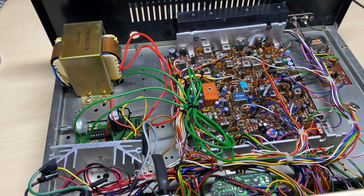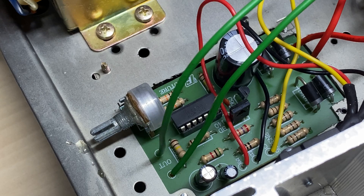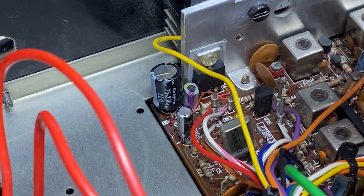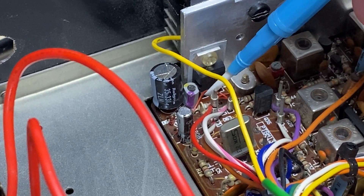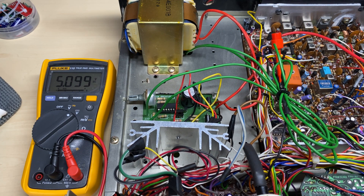Immediately I can see the power supply has been replaced with something, but that seems to be working so I'm not going to mess with that — maybe it's some form of variable power supply with a potentiometer, but that shouldn't be our issue. Let's have a look for the famous rotten tracks. The AVR capacitor looks like it's been changed, and the track is very rotten, but there's also a red wire link linking the rotted area out — somebody's been in here and done the rot work. Looking closer, all the usual suspect capacitors have been changed and all the wire links that normally rot have been done. That's a good start.